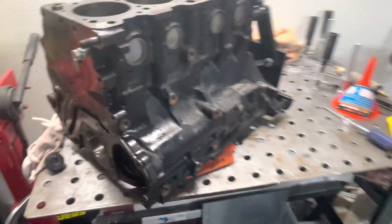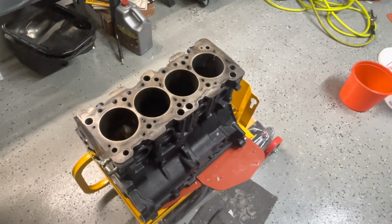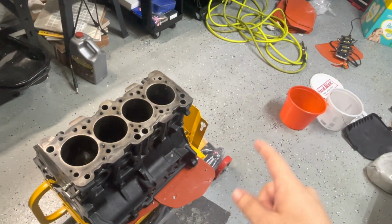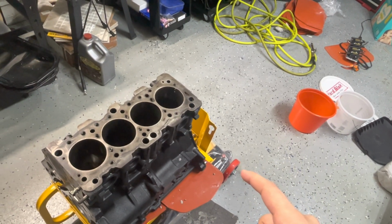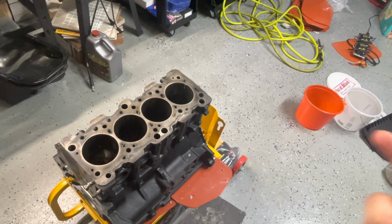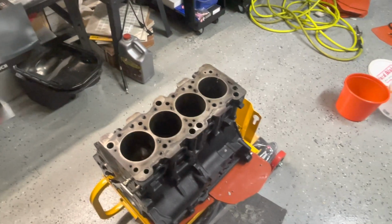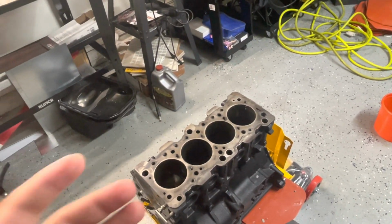So just to give you guys kind of an idea what happened. I mixed the cement in the bucket there. Sorry, I have a mess. I mixed it with cold water, because cold water gives you more time to work with the cement before it settles or sets up. So I filled this block up and looked in my bucket, and I had enough to fill that block.